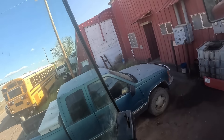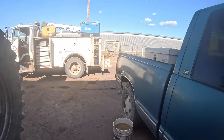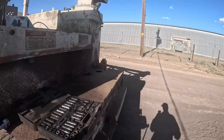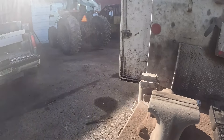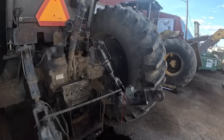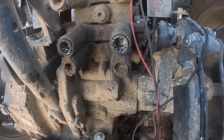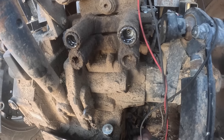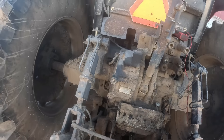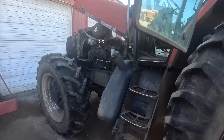I'll put this borrowed module on my bumper because I've got to go put it back in the other tractor first thing in the morning. I was pretty certain that's what it was — that's what the book said. If there was any voltage at all on this wire with key on, engine off, the control module is bad. The book was right. All right guys — another problem solved.